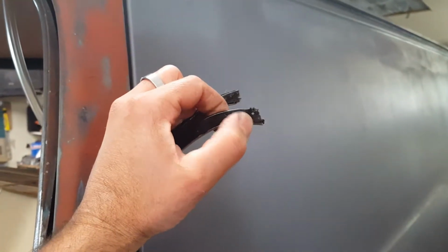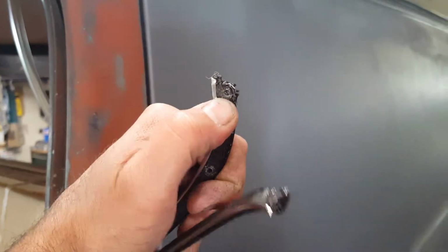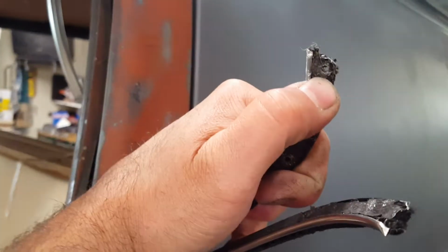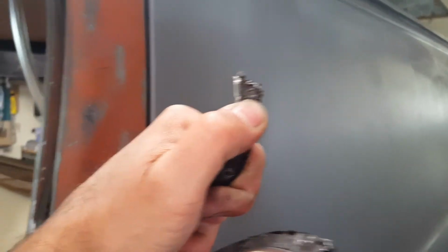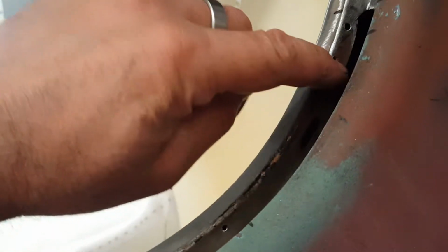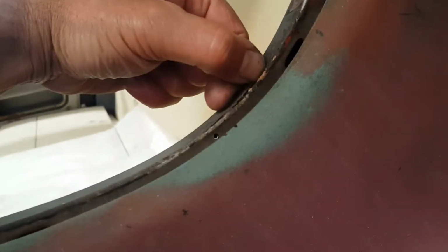So you see the little hole through there. You want to bury that through the mohair. And it goes on the other side. And this is like a metal, extruded metal with rubber and mohair. So it's all together. You want to go through all three materials. You got the idea. You go through all three materials. You go into the steel. And that cinches it down. And then you take this lip that's right here, and that lip goes right on the top of this edge. Okay? That stainless reveal goes right on the top of the edge all the way down to the other side.